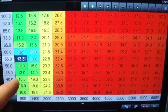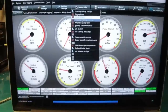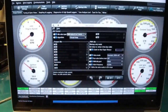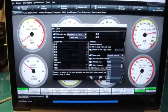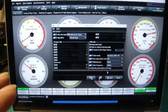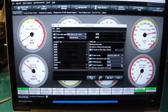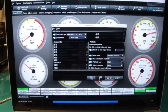You could probably fine-tune it a little more, and you need to find out where your car likes to idle — what timing range it prefers — because every car is different. One thing I do recommend: go to Startup Idle, then Idle Control, and down here is your Valve Frequency. You may have to play with this. The valve frequency is your idle air control frequency — the hertz it operates at. If you get that wrong it could cause surging or a hanging idle. I typically use somewhere around 330 to 440.